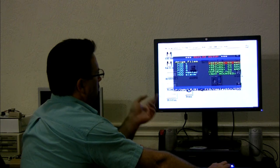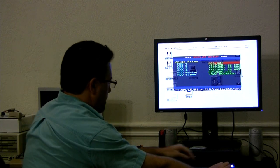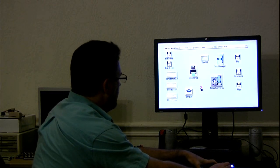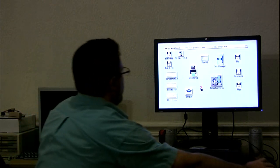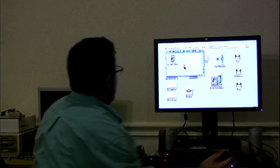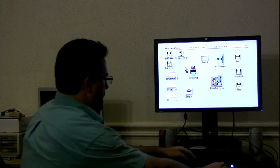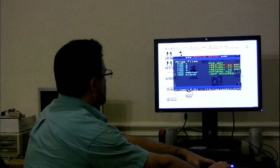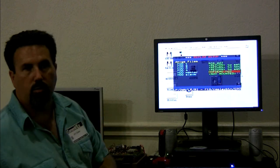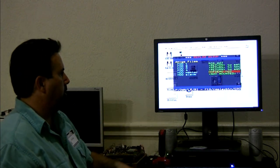On floppies, you can actually mount a floppy — I mounted my old SuperCard Amy — so that's how you select your floppies. Your hard drive is selected the same way. It emulates IDE hardware exactly like the 1200 and 4000 have. You can set your master and slave, select your files, and switch hard drives — you need a reboot, of course.